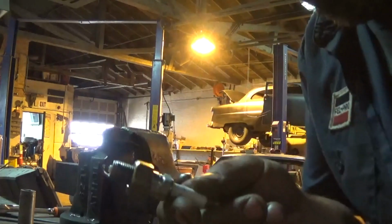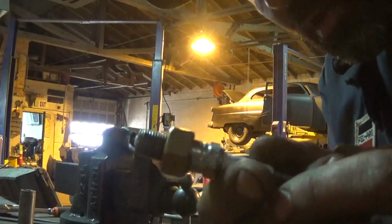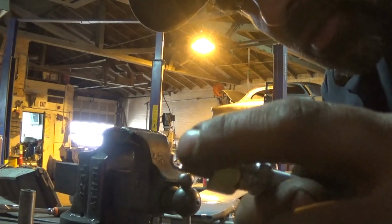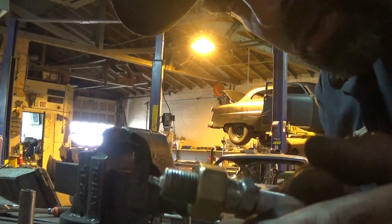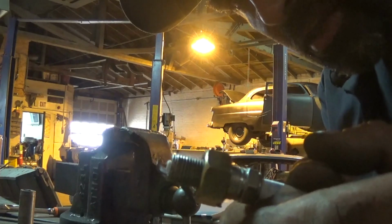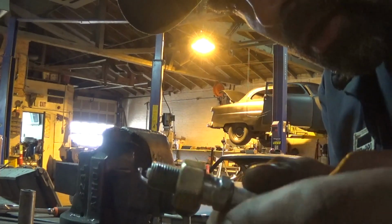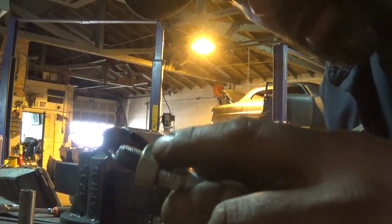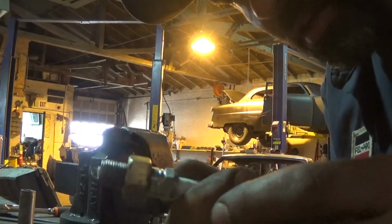Well, this should be just about perfect for our pipe. Got about, I'd say, probably 3/4 of an inch from the outside here to the inside of where the electrode is. That'll get us hanging inside the pipe a good solid 1/2 inch. So I'll pull the nut back off this plug, get my hole drilled in the pipe, weld the nut around it, and that's our bung.